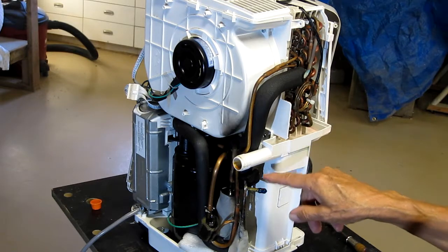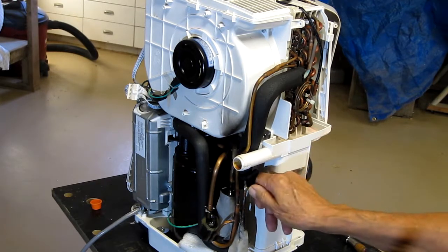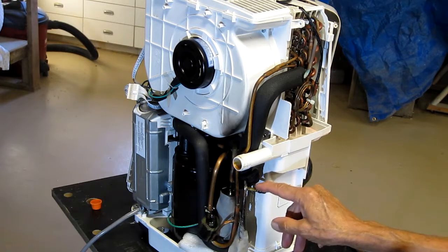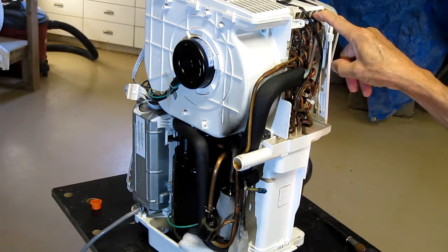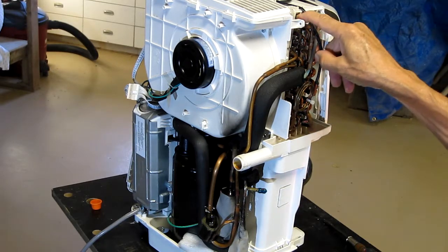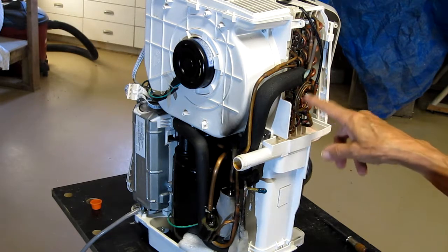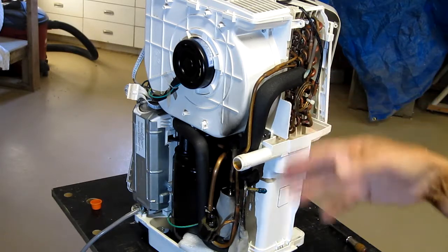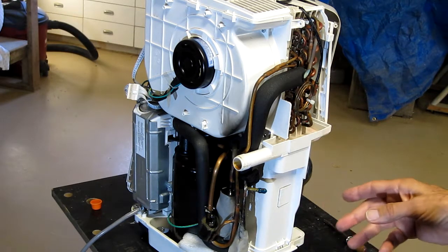At that point, I go ahead and run the compressor, keep it on, and start putting in propane until I can just feel a chill on the suction side, then stop. I've still got some contaminating gas — non-condensibles in the condenser — but it's like one part in 4,000. If I recall Dalton's Law of Partial Pressures correctly, the increased load on the compressor is going to be negligible. There's also the question of whether the capillary tube is the right size for propane — probably not; propane has different pressures, different latent heat, probably different viscosity. But in the spirit of the experiment, we're not going to worry about that.